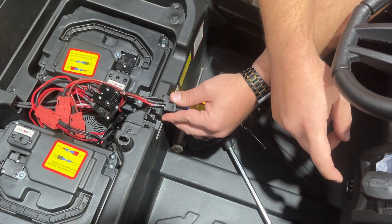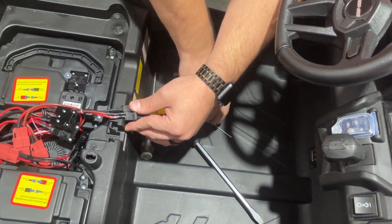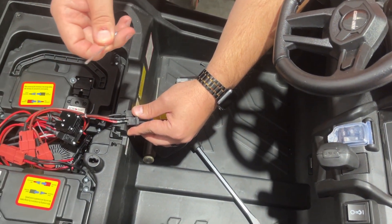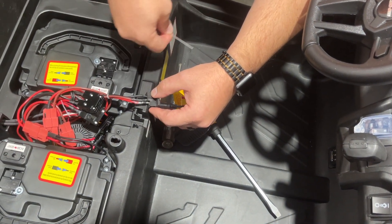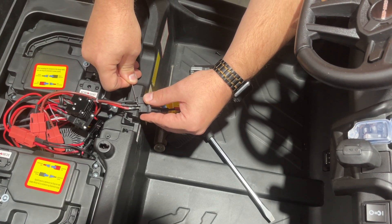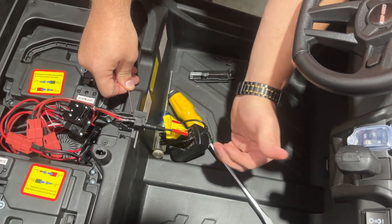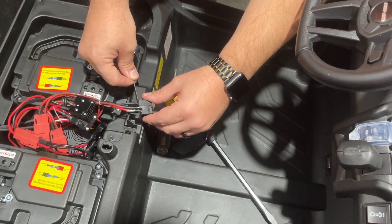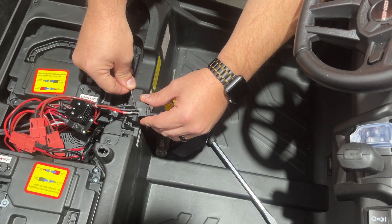When bypassing the charging port, leave the power button in the on position. You can use something metal like a paper clip, a screwdriver, or even your knife — but it might mess up the blade. I use a paper clip. Cross these two wires together that are touching the rectangle, and once we do this, as long as it's in the on position, it should fire up. Don't worry about shocking — it's going to go on the outside of your skin, you won't feel a thing.